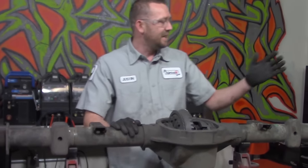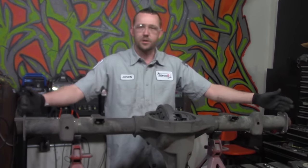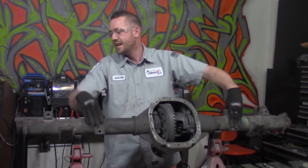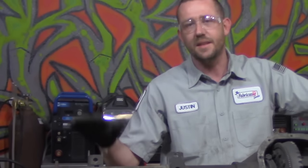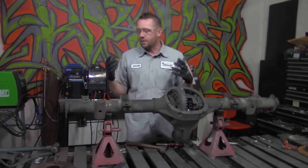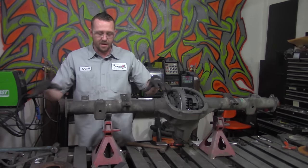The second thing, it was not necessary to actually pull off the backing plates and the brake shoe assemblies. It wasn't necessary, but it does make it easier in this case because I have these tabs that I have to actually cut off of here, and with that backing plate here, it was limiting the accessibility for it. So I just went ahead and removed those. Plus, it makes it a little less bulky and a little bit less difficult to work on when I have this section here that's going to be cut down.